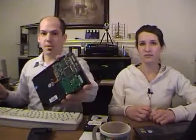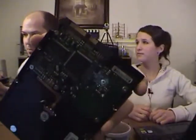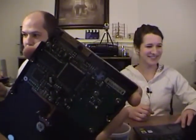So you can see how these pins are. With a SATA drive, on the other hand, let's just pull this drive out of my dock. See how the pins are so much different? These pins just aren't going to break. There's my zoom — a little bit higher resolution. So that's SATA — a little safer. This is EIDE — tons of tiny little pins. Those pins can get bent really easily if you were using something like a dock.